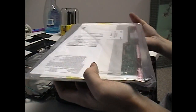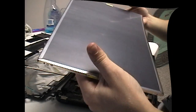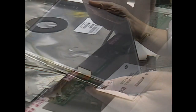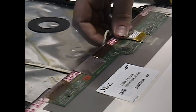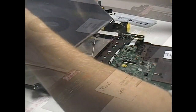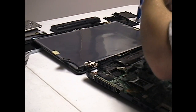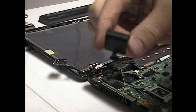Here's the new LCD. It looks a lot like the old one — a Samsung, still wrapped up. I'm going to leave the protective cover on the monitor as long as I can so I don't get fingerprints on it. Go ahead and put the little frame pieces back on, plug the monitor cable back in, tape it back down the same as it was before, and put the whole thing back into the base. From here it's just a matter of reattaching those six screws that hold it into the back plate, and then the hinge covers go back on and are screwed back in as well.